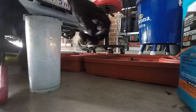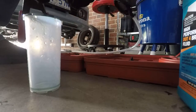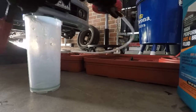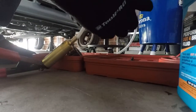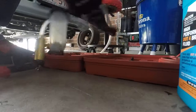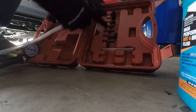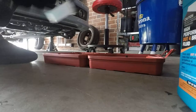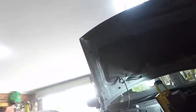Alright, so there's a few fittings. This side just fits straight onto your pump — it's got a little barb fitting on the end. Then you've got basically a little waste container so all the brake fluid that you suck out will end up in the container. On this end you've got another barb fitting, and the kit does come with a bunch of different fittings so depending on what your bleeder screw looks like there should be a fitting to work on it.